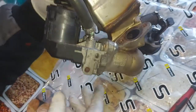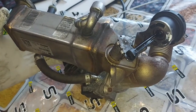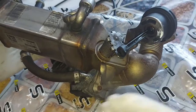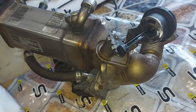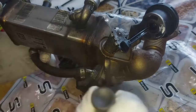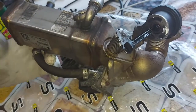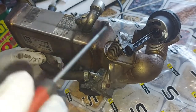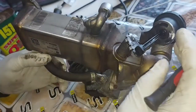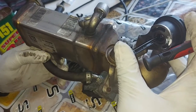That's how the EGR valve works. The cooler is there to take heat away from the gases so there's no effect of rising heat in the combustion chamber — because the whole idea is to reduce heat, since heat is what causes nitrogen oxide formation through the reaction between nitrogen and oxygen. That reaction happens from around 2000 degrees Celsius, which is when nitrogen dioxide and nitrogen monoxide form.